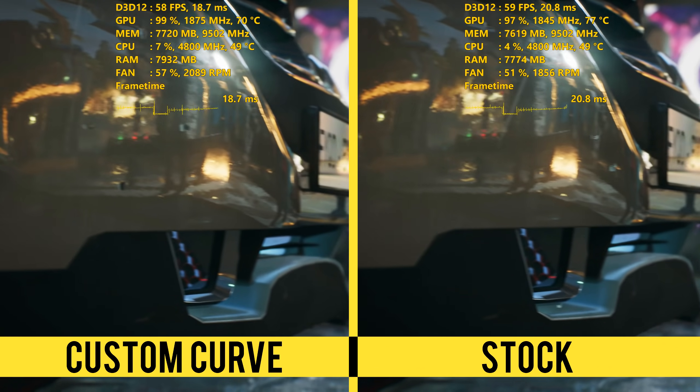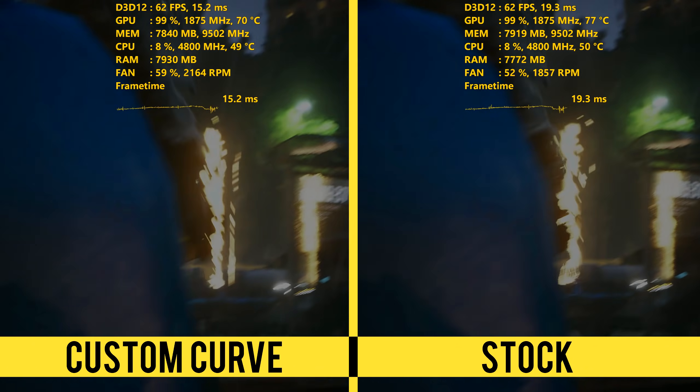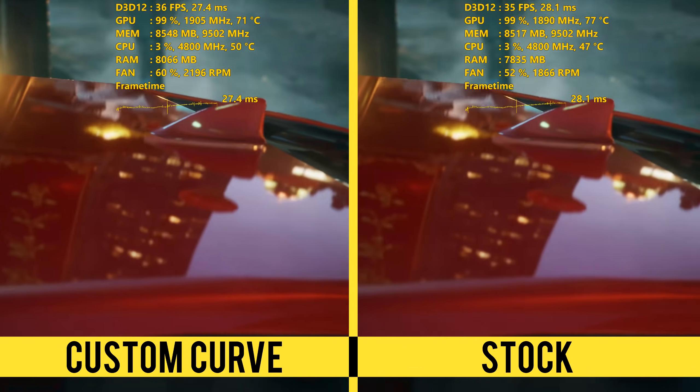For this tweak, you are going to be using MSI Afterburner, although you may be able to do it in other overclocking software like EVGA Precision X or whatever else you might be using. I just personally prefer the layout of MSI Afterburner — I'll have a link in the description below. The tweak I'm talking about is really to just use the default custom fan curve within MSI Afterburner, which is not enabled by default. It helps the card run a fair amount cooler — about 5 degrees in the test I'm doing here. I've got some side-by-side comparison on my RTX 3080 Founders Edition on the Bright Memory Infinite Benchmark, which is a fairly new benchmark over on Steam.